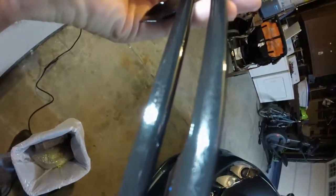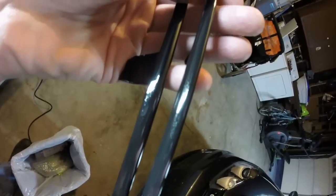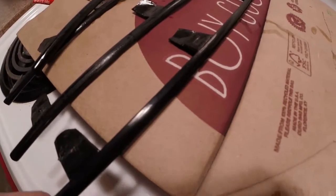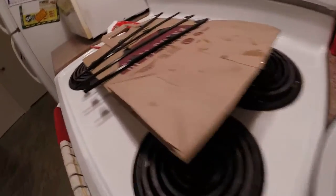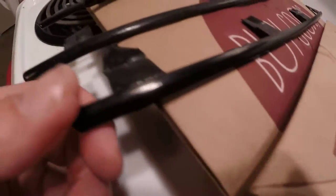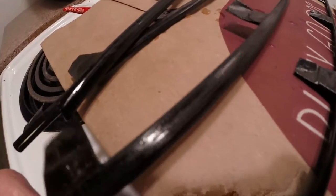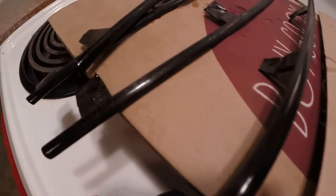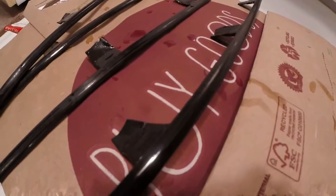I do have some spotting right here — you can see it's not perfect, but I'm hoping the sanding will take care of that. You can see here I've just done the first step of 3M cutting rubbing compound. The old ones have that flat, scraped look to them, and this compounded one got rid of all those lines and grayness out of it. Now it's kind of consistent.